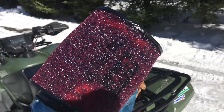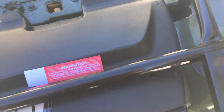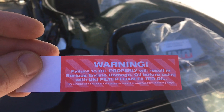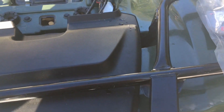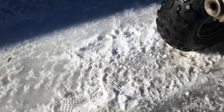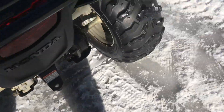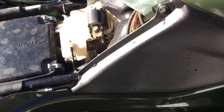I'll show you how to put it in. While our filter's over there drying in the sun, here's a little slip that comes in your package and tells you whether or not it needs to be oiled. It also comes with two stickers, and UNI makes their own little kits. You can buy a spray oil or just get a simple oil. I got this at a Honda dealership for about seven bucks — it's a Bell Ray oil. I've used it on six different filters with the same canister and it's still only about two-thirds gone, so it works great.